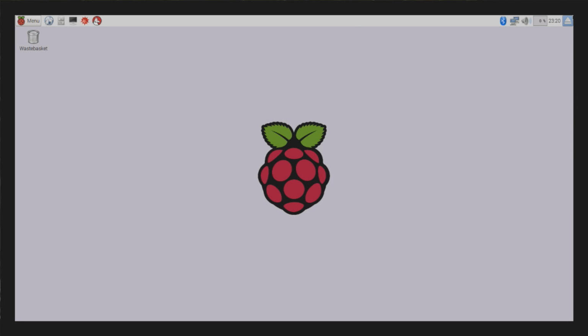And what we're going to do is set this up as a Plex Media Server. So this little device can be in a closet somewhere, plugged into Ethernet, or even on Wi-Fi, although I would recommend that you use Ethernet if you can. That is because if you've got the kids watching it on the TV and you're watching it on your phone and your tablet or whatever else, Wi-Fi bandwidth, as you know, is not as fast and reliable as Ethernet.